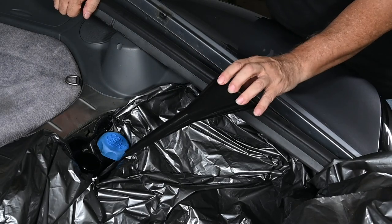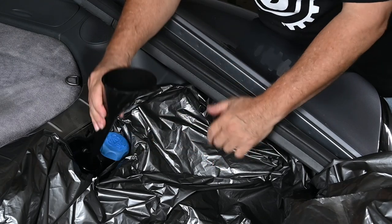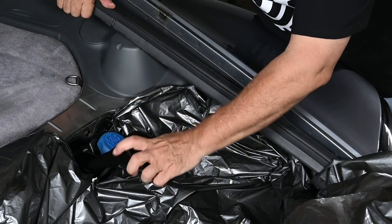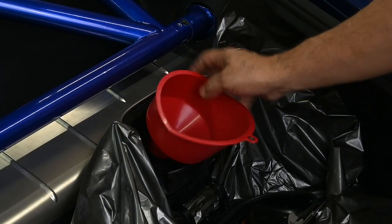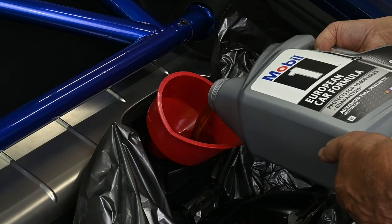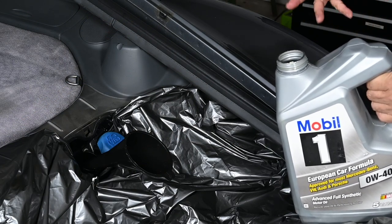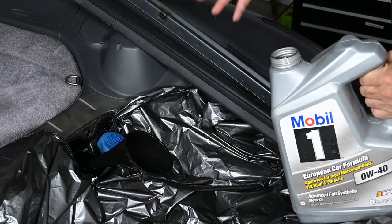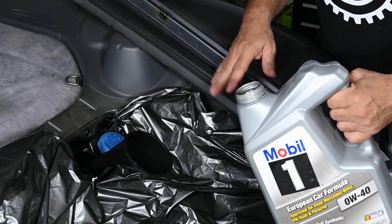One tool I forgot to mention: a funnel. I like this particular funnel because it has a slanted cut — you can't put the funnel in straight because the tube runs diagonal, so you stick it in at an angle and pour directly onto that wide open surface. Since recording this, I found another funnel I like much better that fits perfectly and makes pouring much easier — it seems almost custom made for this oil fill. I'll link to it in the description. I'm continuing with the first five-quart jug since whatever I put into the oil filter housing counts as part of the eight quarts total. So by pouring this in, I'm now up to five quarts in the system.